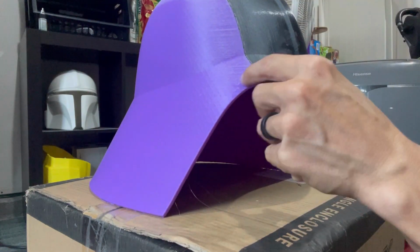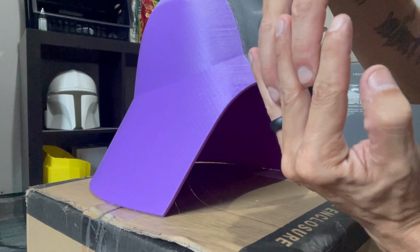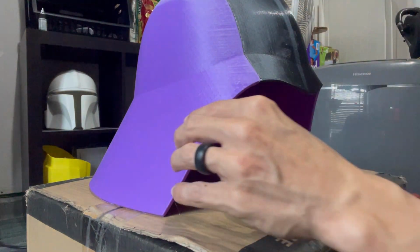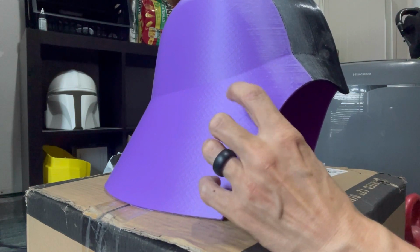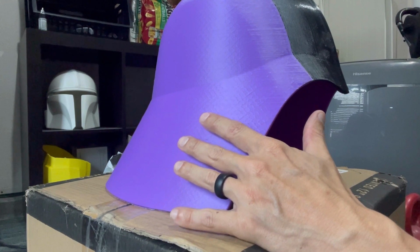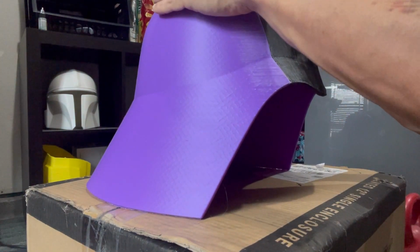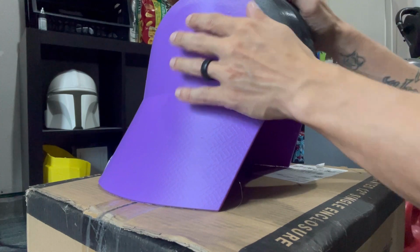That's good. It's got those little fingers to grab. That filler will be able to go into those little craters that we've created with the sandpaper and fill in and give it roots so it grabs on. So that's why I say, if you ever try to put any sort of filler, any sort of primer on this without sanding it, you're going to run into some issues, okay? That's the whole reasoning behind why we want to sand this and have that little bit of grittiness on there.